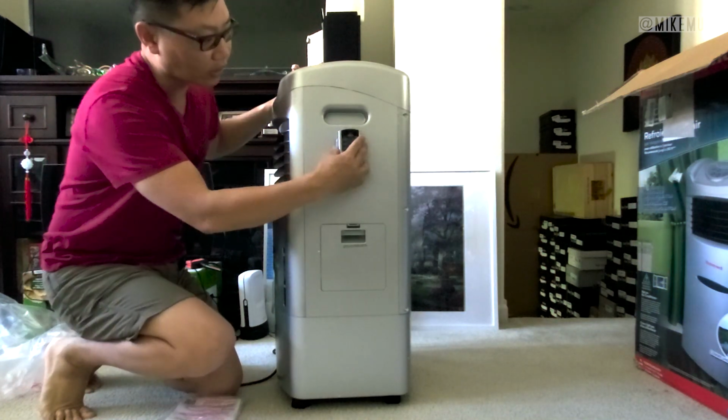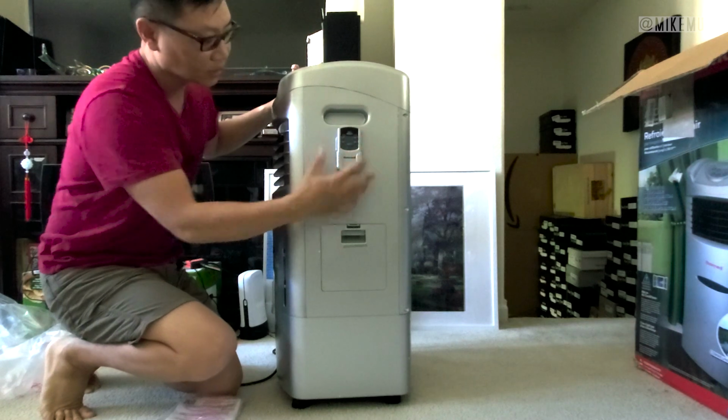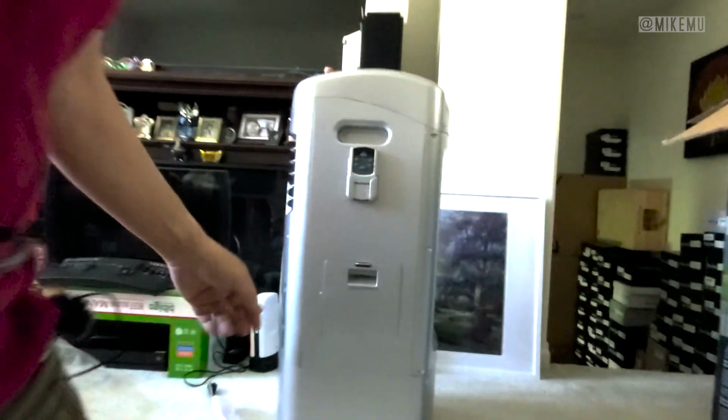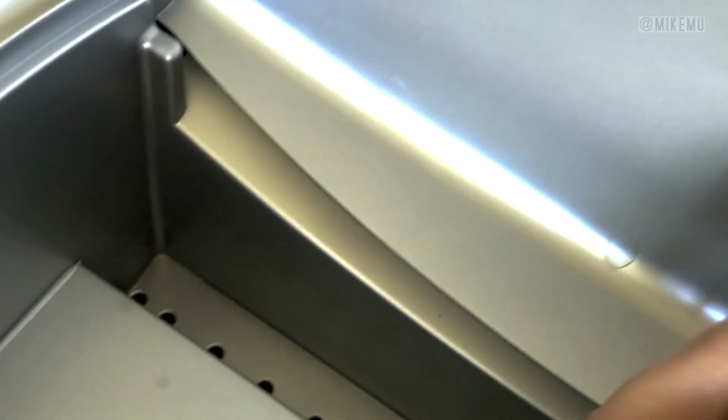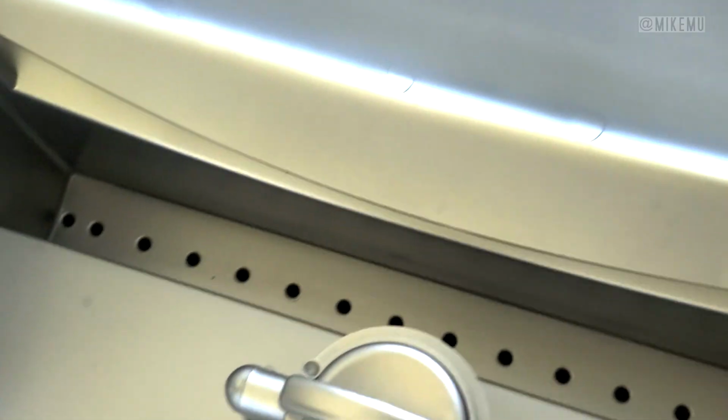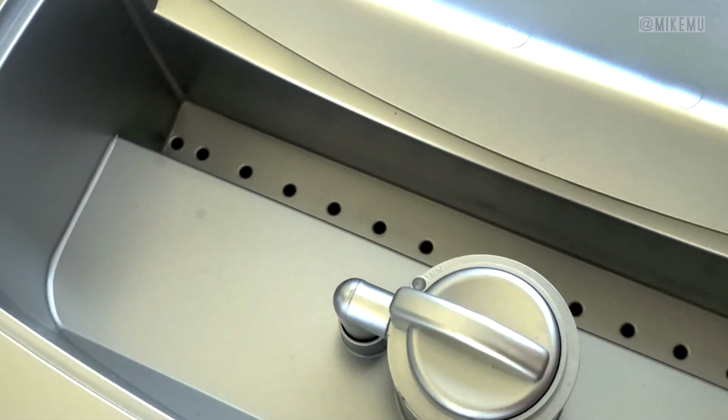Pumps the water up through there and puts it down through this filter media, which I'll show you a little bit closer. Over here, see that in there? That's the filter media. And depending on how well this thing performs, that's pretty much how well cooling performance you can get in terms of that and the distribution of the water. And this is where I guess I can control the flow from minimum to max. Oh, here we go. Just basically how much flow of water. And then this is how it spreads the water down through the filter media down through here.